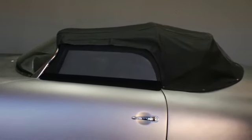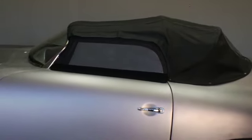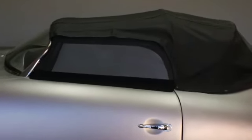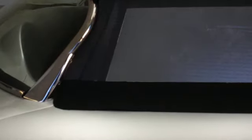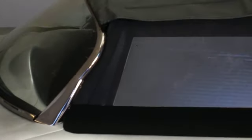The other parts of the side curtain which have to be discussed, and these are the sources of leaking, are the interfaces. The interface of greatest concern is at the windshield. And I will show here, by looking at it from an angle, that you can see that there is light showing between the side curtain, which goes behind the windshield. You can get a little better fit by a little more flexible fabric, and most of them are. And that's really not a problem, even though it looks like one, because it is behind the windshield. The flow of cold, wet air coming at the car at 65 miles per hour is not going to find its way between the side curtain and your windshield because it is behind it. Very smart thinking on Porsche's part.